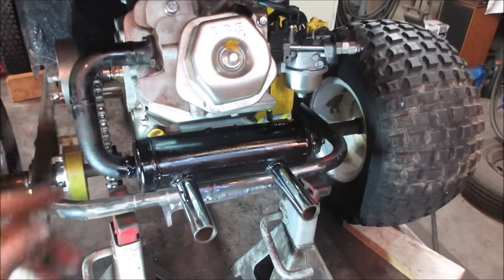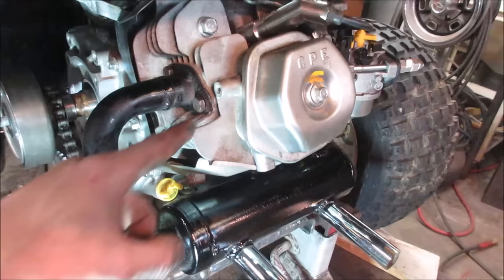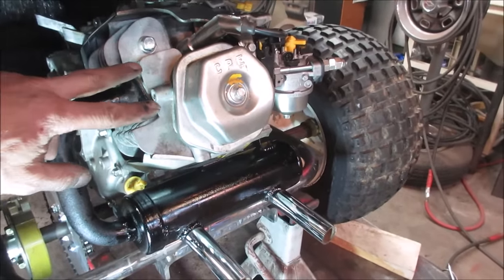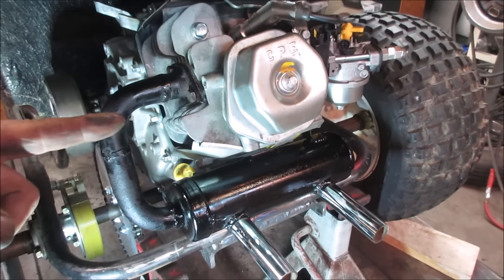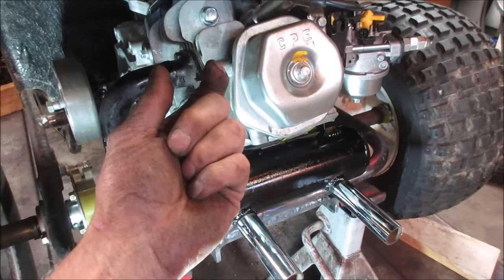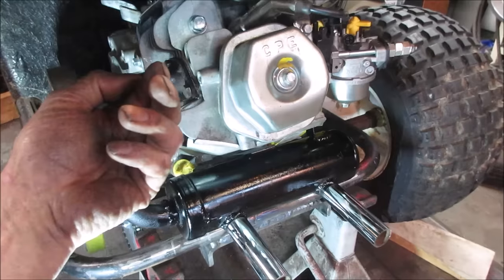Looks decent. How I fixed the bracket setup is I pulled those studs out and I ended up just putting two bolts in. The problem with doing that is you're threading into aluminum, and the reason studs are there is so you don't pull the threads out. Generally, you run a stud in, you grab half an inch, three quarters of an inch of aluminum, and then you run a nut on, and it's got full strength.